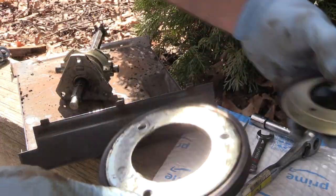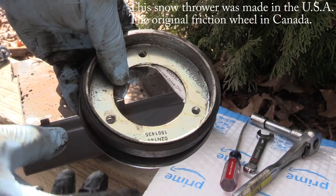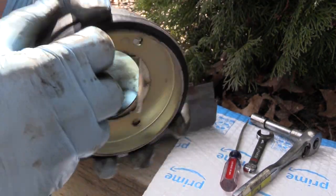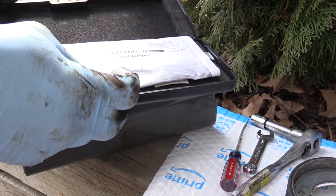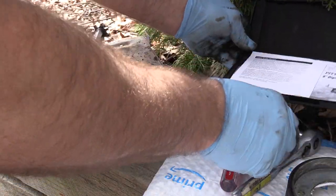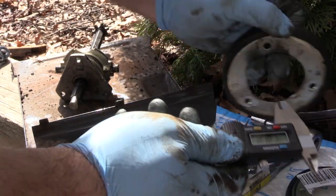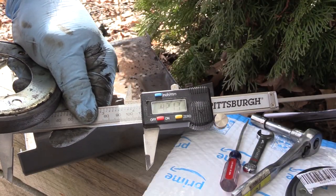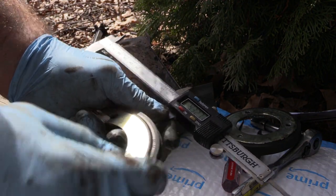Let's take a look at this wheel and compare it to the old one. First, we'll make sure the holes line up — it was the same part number, and yes the holes line up. You can see this wheel is bigger on the lip. Let me grab my calipers. I'll measure the old one first — rough measurement, not looking for precision — 4.217. The new one measures 4.327. Interesting — not that much off, but enough.